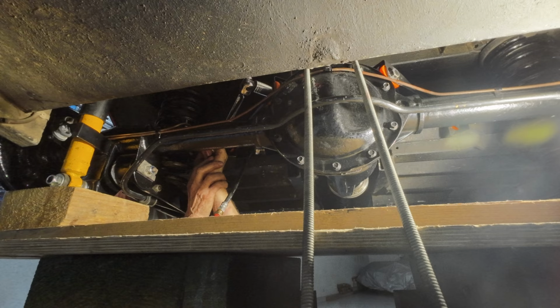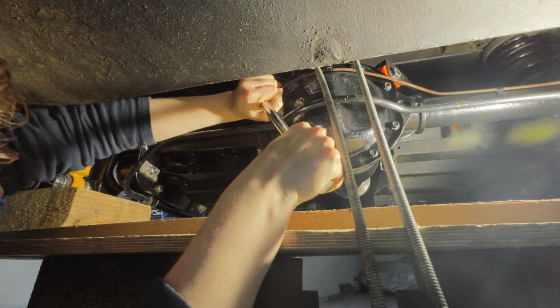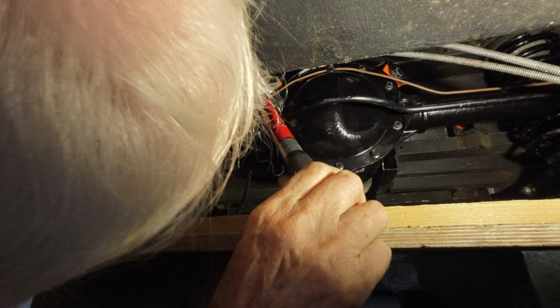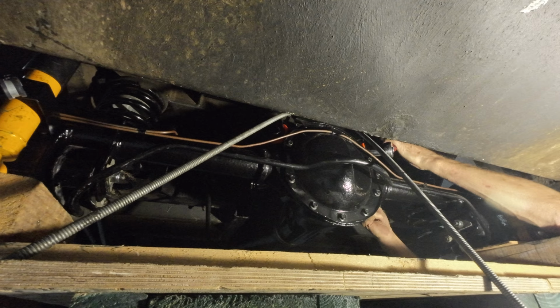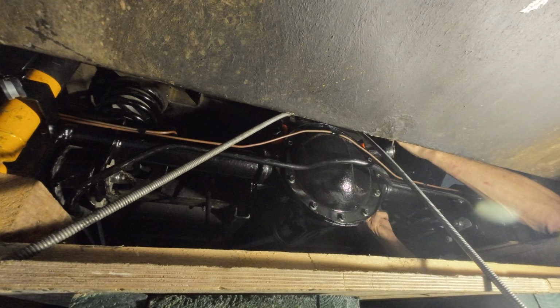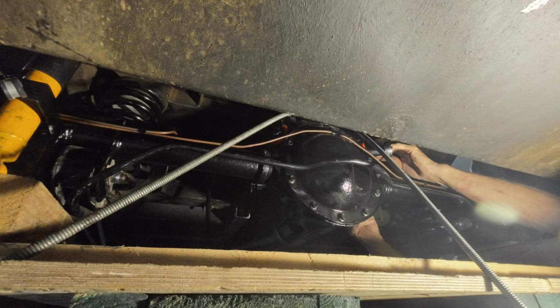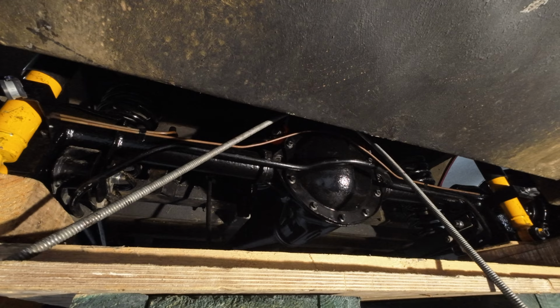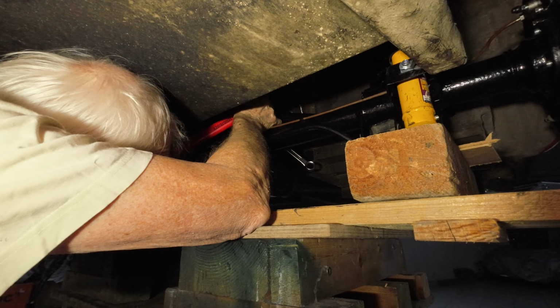It moved them. Right, this time I came to the rescue, briefly. I'm looking at the thing around the other side moving. Is it moving? And you should be turning with the nut, not with the head. The nut should be the other way around, if you follow me, because it's not slipping. Because the nut, with a washer on it, has a bit of lubrication. It's moving at the back, Dad. Right. Do you want me to hold it from the back? Right. I'm holding. You hold it.